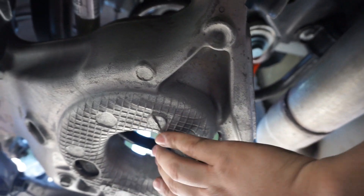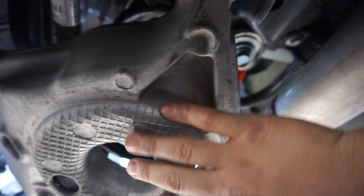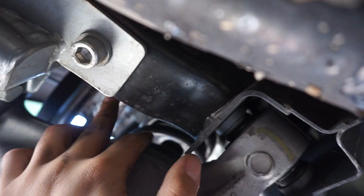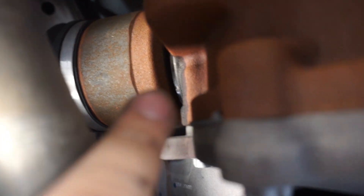So this is the independent rear suspension. Here's where the lowering spring goes in, just so you guys get an idea of what we're looking at. Right next to it is the half shaft. Keep in mind we're on jack stands so it's kind of tied up in here. The half shaft runs and connects at the pumpkin right there, so we have to get up in there and pry it out. We'll stick a pry bar in there and pry it out.